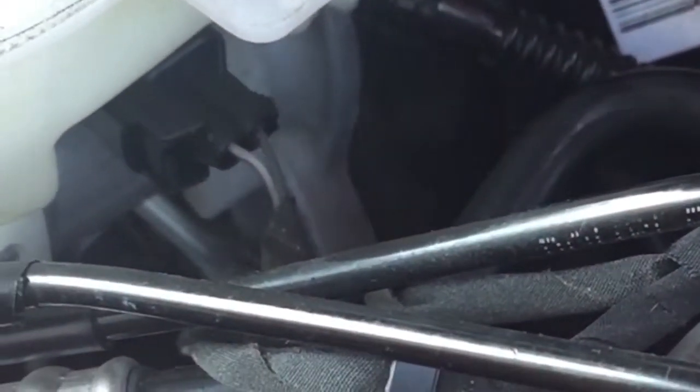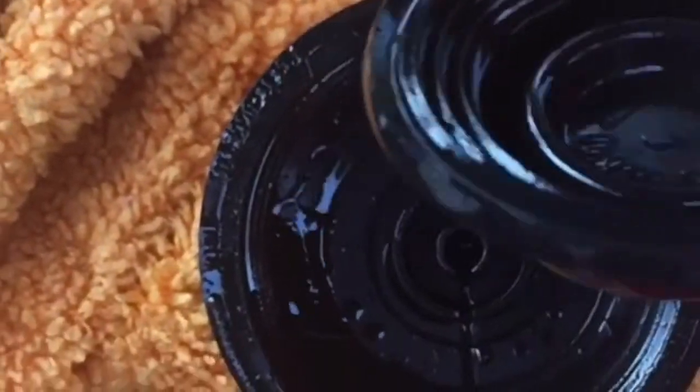And then the new hose, you just slip it right on, put the clamps on it, fill it back up, pump your clutch and your brakes, because this is a clutch and a brake reservoir. So also you want to keep an eye on this rubber piece right here. I don't know, but I'm starting to think this fluid may be eating this away a little bit. Could be just me being paranoid. Anyways, I'll give an update.